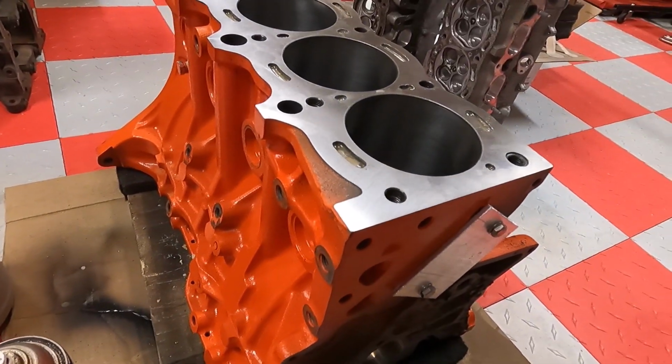So I just wanted to put together a fast video for you guys, and there's nothing to it. Patience is the biggest thing. You've got to take your time when you're doing it so you don't make a mess. You can make a mess if the block wasn't machined. I have another block over there for our personal drag car that hasn't been machined yet. They did line bore it for main caps, but that one I'll fill, take my time, and if it makes a mess and pours over everywhere, it doesn't matter because it's going to go off to the machine shop anyways. I'll put together a video when I do that block, so you can see it from beginning to end and get a better understanding of how we do it. But I wanted to show you now, just to give you a heads up on how we cement the blocks.